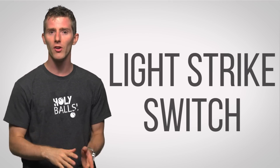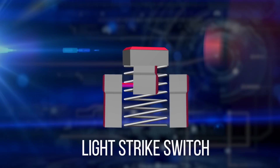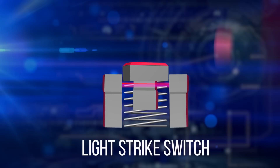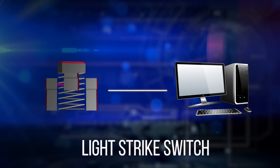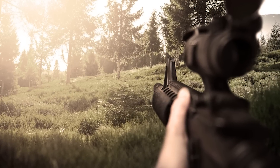Unlike the huge variety of purely mechanical switches, there are only two main types of optical switches out there right now, since the technology is rather new. The first type is called a light strike switch, also called an LK switch. These work with a more or less traditional mechanical shaft that blocks an infrared laser beam when it's idle. But when you press down, the beam is allowed to hit a sensor on the other side of the switch, which registers a key press. This allows for faster response times when gaming, because LK switches register keystrokes after traveling just one and a half millimeters downward, about 25% less than most current mechanical keyboards. The manufacturer also claims that actual response times could be as low as a fifth of one millisecond.